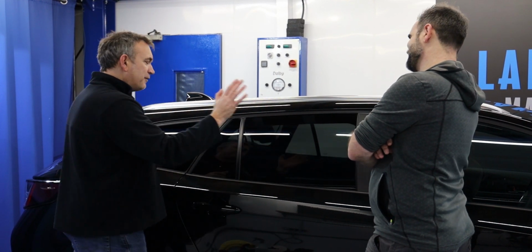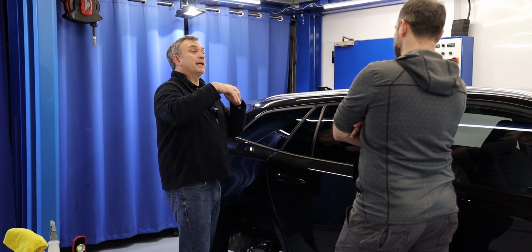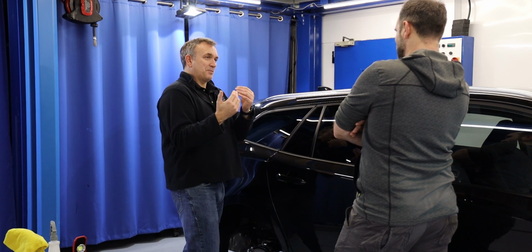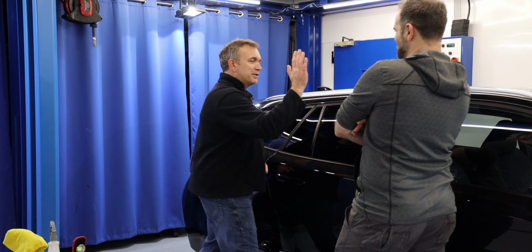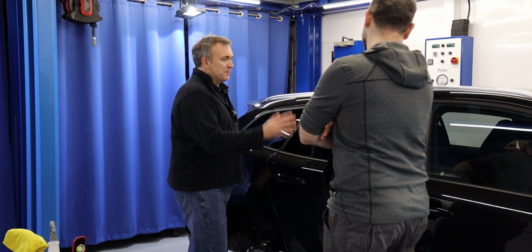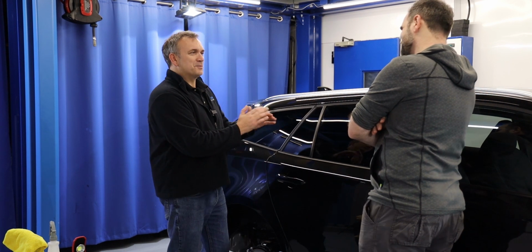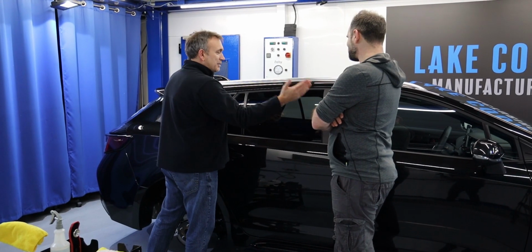And we think they don't do the windscreens, from what I was told a long time ago, because it will wear down from abrasion, and then customers will take it back to Porsche saying, what's wrong with my windscreen, it's not working anymore. So they only do the side windows normally. But yeah, that's one thing. Don't just go straight in and polish, because you might get a customer's car and you might actually be taking off a coating. But this wasn't beading. You know it's your car.